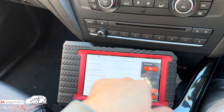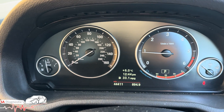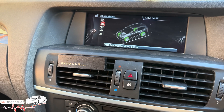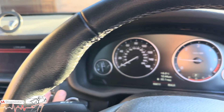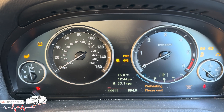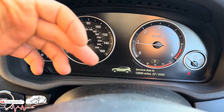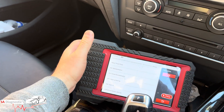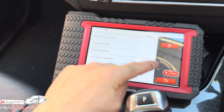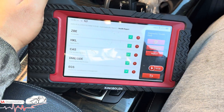Let's turn the car on and see if we get any warnings — nothing, as you can see. If we go to menu, vehicle information, vehicle status, check control — bingo, nothing. And remember, if you're changing the steering angle sensor, it's the same process — literally nothing different. There are many other things we can do, and the other thing is the DPF.